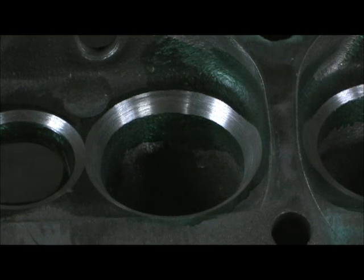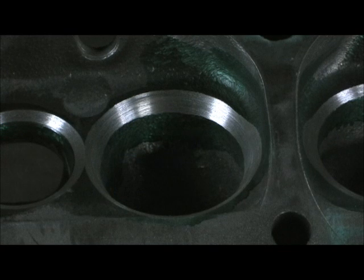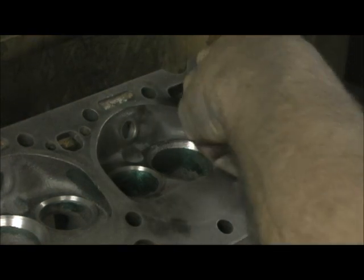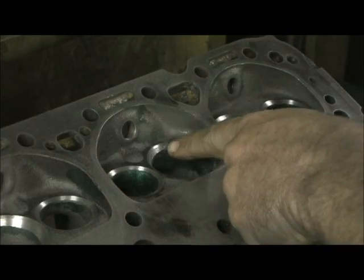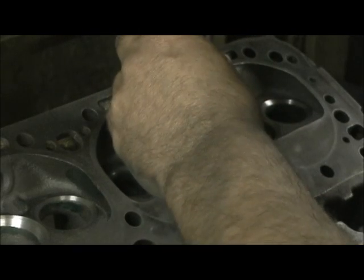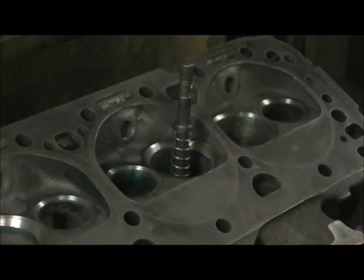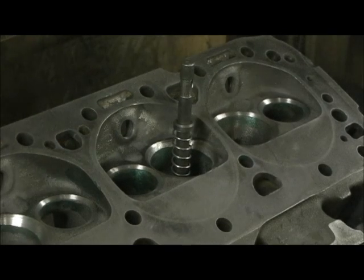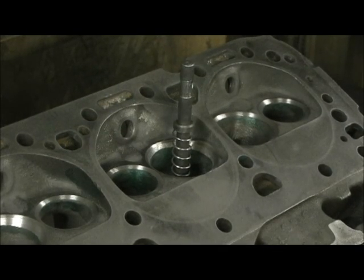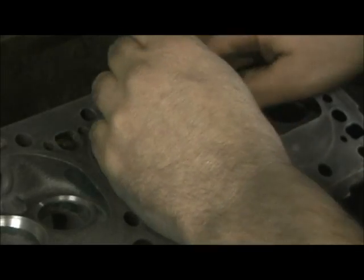It's attention to detail and going that extra mile that gets every bit of power out of this engine — you just can't buy a pair of heads like this out of the box. Sometimes when you're digging, and this is what takes all the time, I just did the 60 and 30 on this one, but when I hit it on the valve it was too far down the edge. So I'm going to go back with a 30 top cut and just kiss it some to bring it back down.